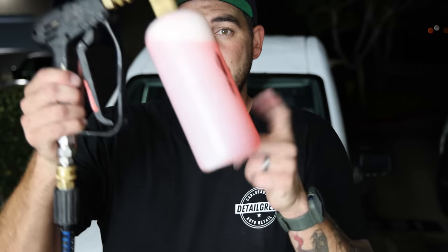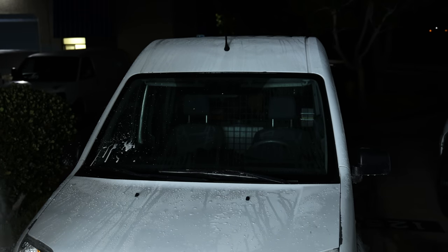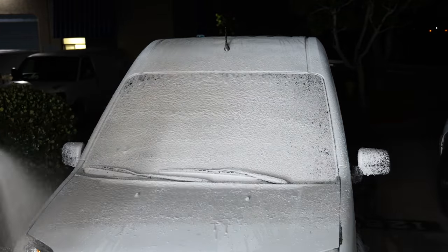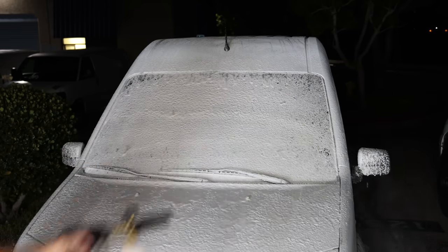Last up to compare, we're using Adam's Mega Foam. The MJJC soap and the Meguiar's Ultimate Snow Foam both got 3.3 ounces, and then for Adam's I'm only using 2 ounces of product. Going onto a wet panel again. Adam's Mega Foam is still the leader on highest foam content just out of the soap, even at a lower dose. But does that mean it's better? Absolutely not. The cleaning ability and lubrication are the key factors — especially when considering a pH neutral soap.